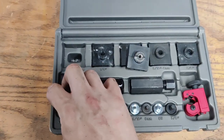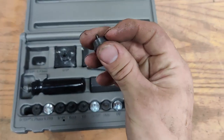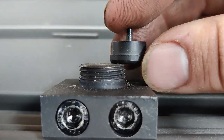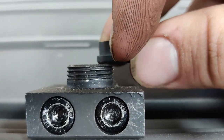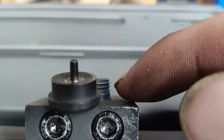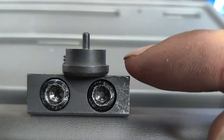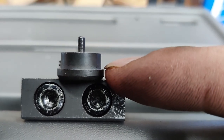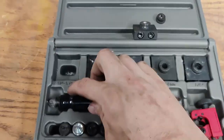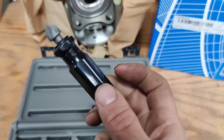This isn't really a how-to video but I'll show you real quick how you flare these lines. You take the appropriate adapter or die and get your line set up inside the block. You want just enough line sticking out to match that first shoulder — only about a 16th of an inch. You clamp the block down using the two hex nuts. This kit comes with a reaming tool, and between each step you use it to clean out the tube, which allowed me to get a very clean and precise flare every time.